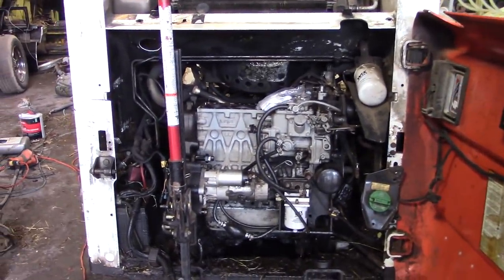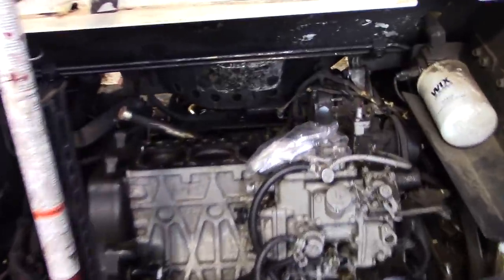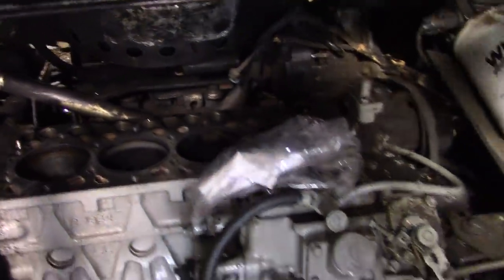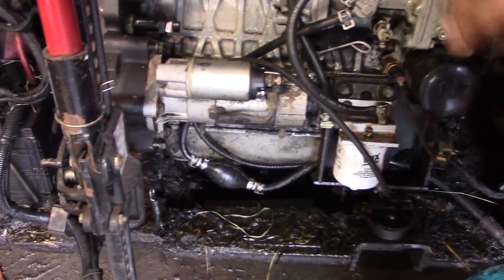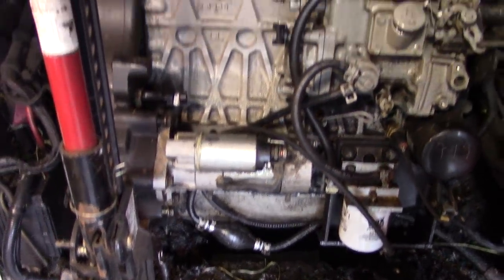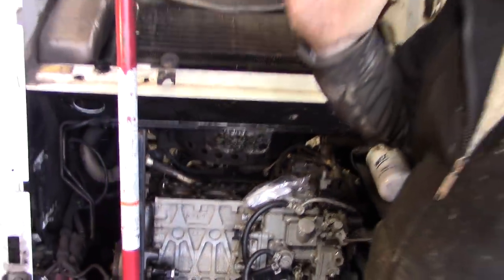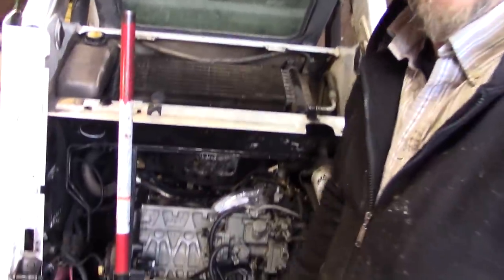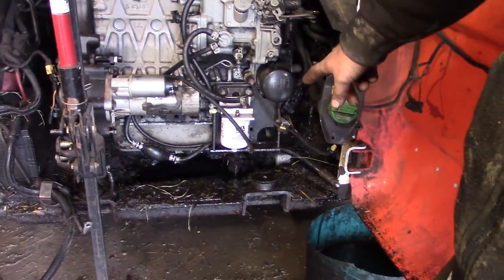If you look there, we got the head pulled off. The cow is having a fuss. I got the head off. We took these two back motor mounts out. On the back side we left the tube front end, and my idea was I was wondering if the engine would tip up if we got enough room. So we got the handyman jack out. We hooked it here on the flywheel housing and sure enough, we jacked it up six inches.